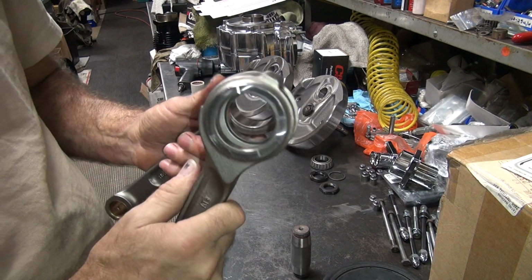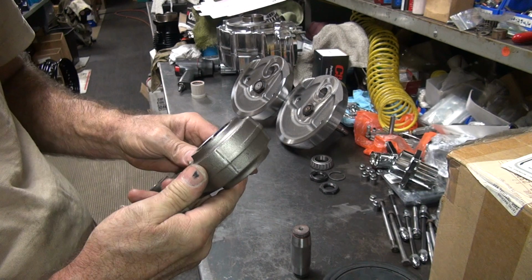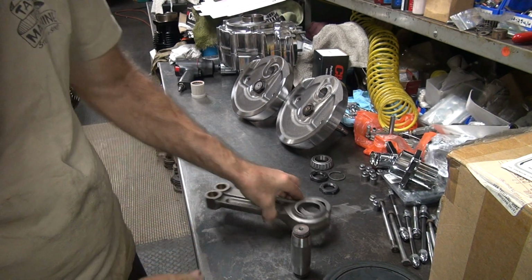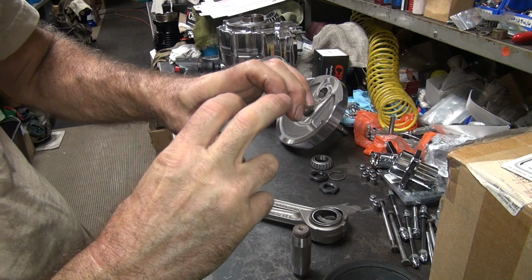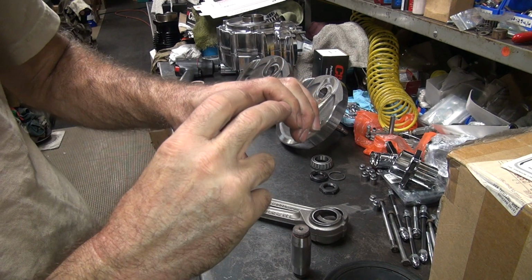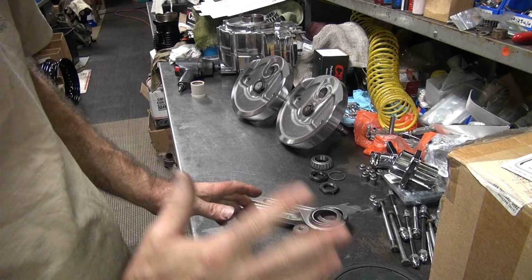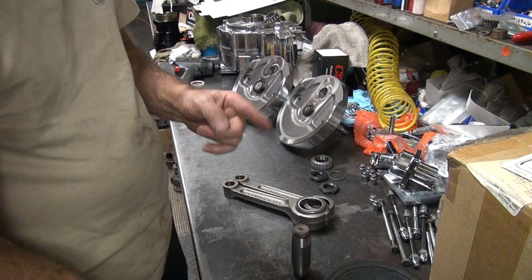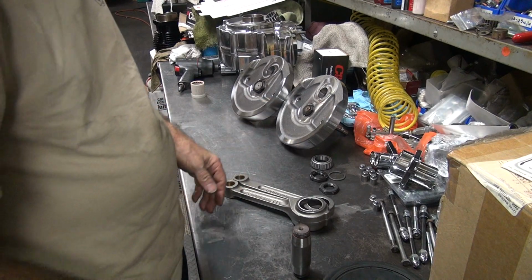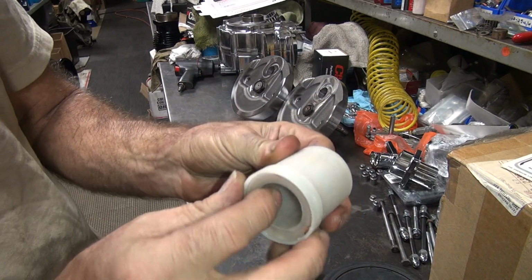This was at 0 to under, so if you go 0, that's 1.3 clearance. And when it closed up that 7/10, we dropped to about 6/10 clearance on the tightest spot, but then it got really loose in the one spot. Everything else is just way loose, assuming the bearings are standard. Now we don't know what the bearings are because it comes in that kit, which are right here. I got them all cleaned up, but I got to measure them.